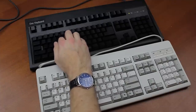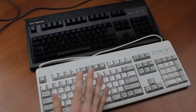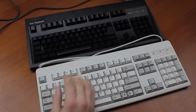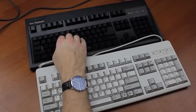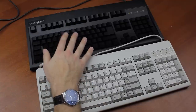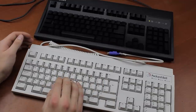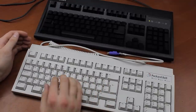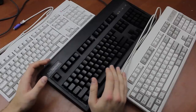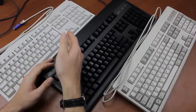That said, the key feel is pretty solid. I'm starting to see what people like so much about these now. Compared to a RealForce, it's significantly more tactile across the entire board. With the RealForce it's well known that the lighter the keys are, the less tactile they become, with the lightest ones being virtually linear. But the differences in tactility are smaller on the ErgoForce, and even the lightest ErgoForce domes are more tactile than the stiffest, most tactile Topre ones. Both in magnitude and sharpness, the tactile bump is greater everywhere on the DAS than on the RealForce. It's not quite as tactile as a BTC dome-with-slider keyboard, which have exceptional tactility. It's also kind of between the two in terms of sound — definitely louder and more rattly than a RealForce, but not as loud as a BTC, which is one of the loudest rubber domes I know.